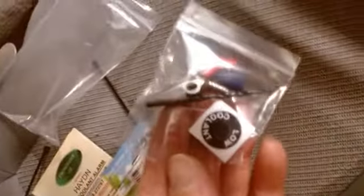I've had a little look at the instructions - there's cable ties and bits in the kit, and a nice little sticker to go around the LED. I think I'm gonna stick it up through here somewhere in one of these little places. Most of the work with this little gizmo is going to be around the fuse box area. Paul said wire it into the fuse box, find a fuse that turns off with the ignition. Locate the buzzer up underneath the steering column - there's plenty of space. The sensor screws into a little hole in the header tank.